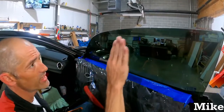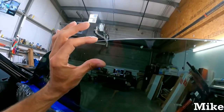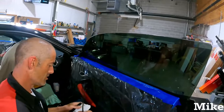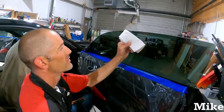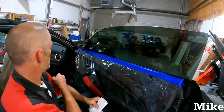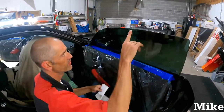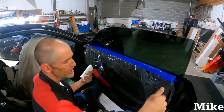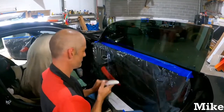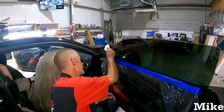If you don't shave that or anything, it's going to pop back. See? You can start to see the air bubble there, just from popping back, from having that little bit of edge to grab onto. So you want to file it, or like you said, move it down just a micro, millimeter, centimeter, whatever. Just get it just off that edge. If the pattern's messed up or there's a little nick in it, you shave it and pull it down. But if you don't pull it down after you shave it, I'm telling you, you're redoing it. Not sure exactly when, but you will be redoing it.